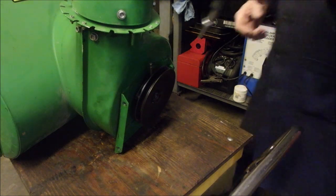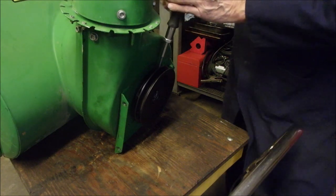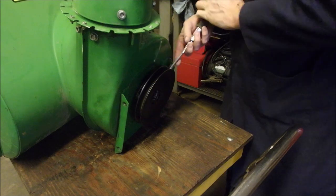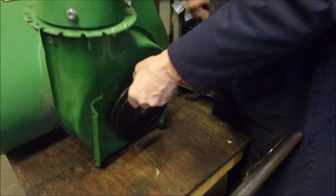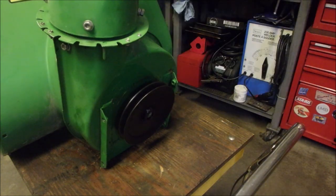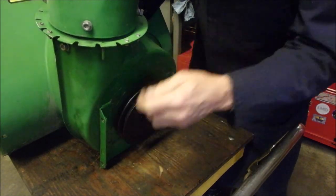And I'm not going to wrench tighten it until I actually get it onto the snowblower, because I'm going to put red Loctite on these grub screws. What? Oh, there we go. Now that should spin as good as before. Which direction does the engine spin that baby? Spins this clockwise. Good.